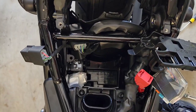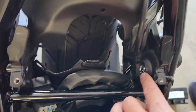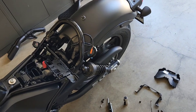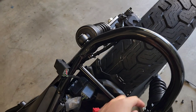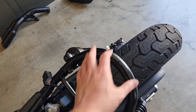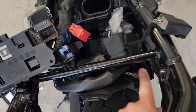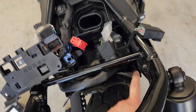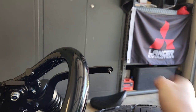I can now finally get to this last 14mm bolt and then the fender will slide off backwards. I was able to undo that last 14mm and slide out the whole rear fender. One thing I noted while pulling it out is that this part of the harness goes around this little ball part. The way these brackets go is that it's arch up and the bolts face in.